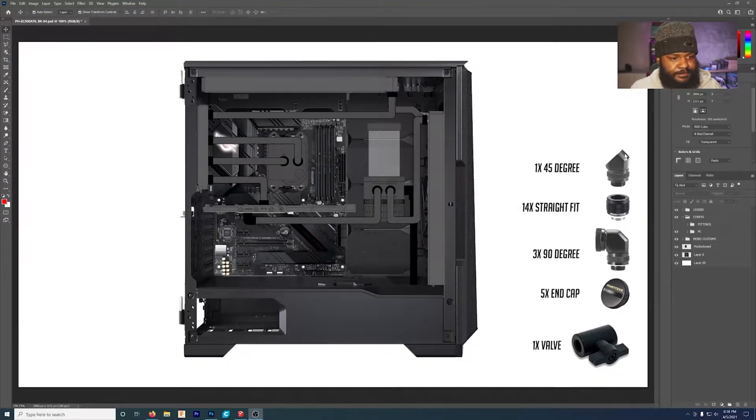You can see here I have my case and all of the parts that I believe I'll be using: the CPU water block, the GPU water block, my pump/res combo, my two radiators, and my distro plate. I've roughed out where the tubing will go, in addition to my drain port. I did find out that the P500A has a drain port at the bottom, so this drain tube that seemingly goes into nowhere will actually go somewhere — and I'm definitely going to need a pass-through fitting.